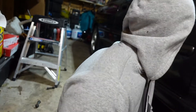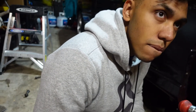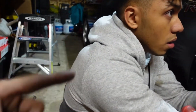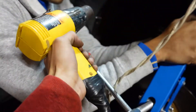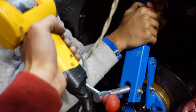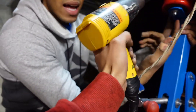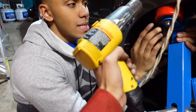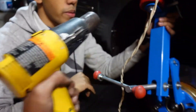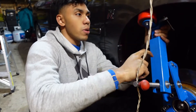We'll finish rolling this side and then hit the other side. We're rolling the rears because that's the one that rubs really bad — it was cutting into my tires. The driver's side is higher than the passenger side so we have to adjust that. Just make sure not to heat up one section too much. One thing we learned: slowly add tension — if it's rolling back and forth there's tension, and once it stops rolling that's when you want to add a little bit more. We tried it too high and it wasn't rolling anything, and too low it was too soft.